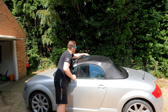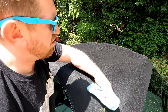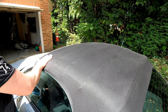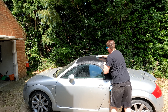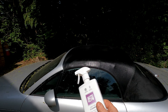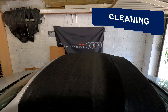Once you've given the hood a good soaking you can lightly dab any stains with a microfibre cloth but refrain from rubbing on an area. You'll notice that the roof is wet — the material should not be holding water like that. One of the treatments we will apply later is a water repellent and I was shocked just how good this worked. With the roof still wet I'm going to get to work on it with the first bottle from the kit, which is the soft top cleaner and the white foam sponge included in the pack, but I need to get this in the garage and out of direct sunlight before I do so.